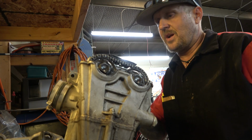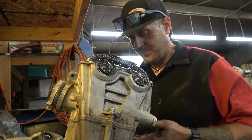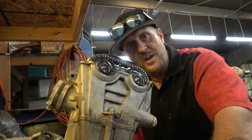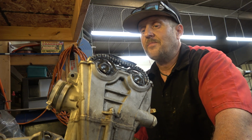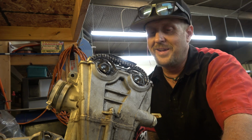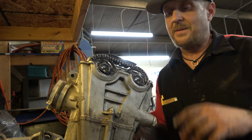All right, to start with, everything up here looks really good so far as I can see. That's a really good feeling, especially if you're new to this channel and haven't watched some of our shop vlogs, because then you wouldn't know that recently, it seems like everything we take apart, the top end is just roached. So that's actually really good to see. Now I'm going to take the cam chain tensioner out so I can loosen that up, pull these cams out, and take the head off.